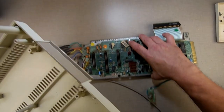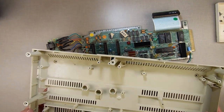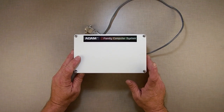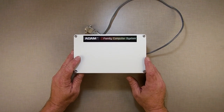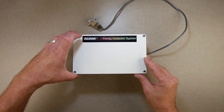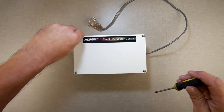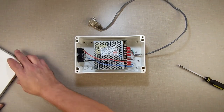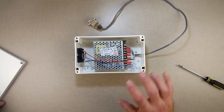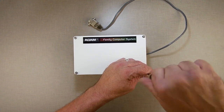We've now completely pulled the ColecoVision Adam down. That's our original base — set that aside and save it, because you'll want it later if you want to make your Adam original again. This right here is one of the external power supplies that I have built and sold — about 70 or so over the past couple years. They're very reliable. You unplug the printer and just plug this in, with an on/off switch. Inside it has a MeanWell RT50A power supply — a brand new power supply.